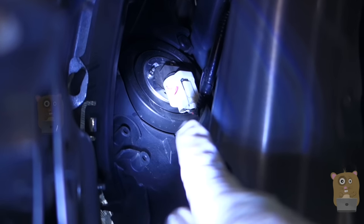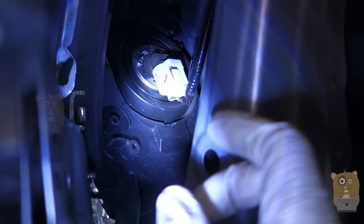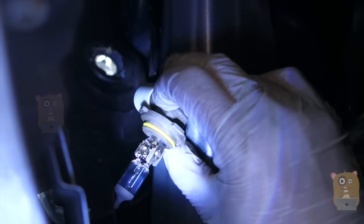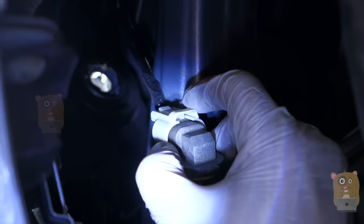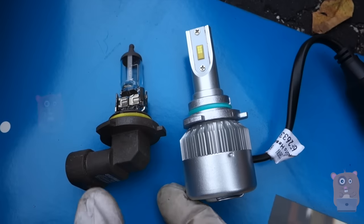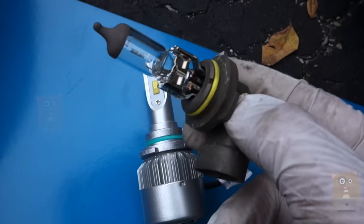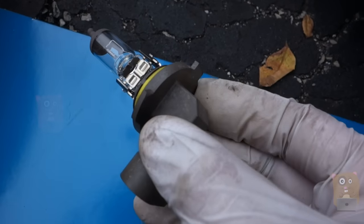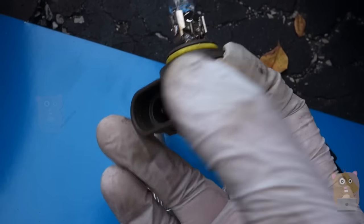I pull the plastic liner back. Now that's the low beam headlight — the one with the white connector. I just need to twist it counterclockwise, then pull it out. Just wiggle it a little bit. I'm going to press this clip and pop it out. Here are the two light bulbs — the left one is the halogen I just took out. To remove it, turn it counterclockwise, pull it out, then unclip the power.